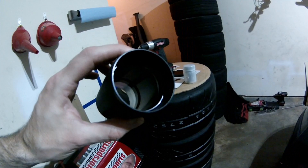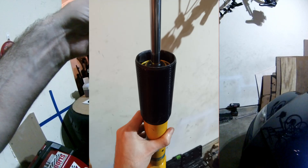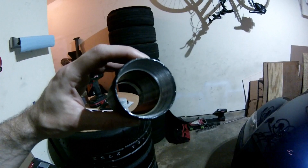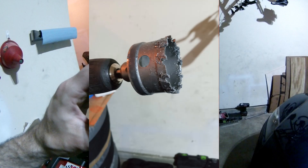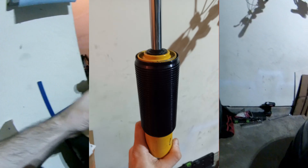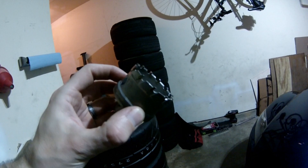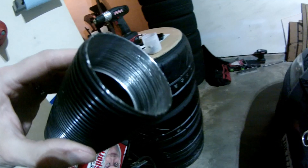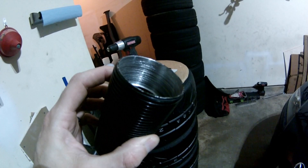What happened was when I inserted the threaded tube in this direction — sliding it down the shock body — it was sticking up too far, and that would cause the body of the car to collide with the body of the threaded collar. So what I did on the opposite side — this was an unsuccessful version — I got a big drill bit and actually machined down one of the stepped grooves on the other side so it was also a square shoulder, allowing me to reverse the tube to drop it further down on the shock body. This is a 53mm hole saw I got off Amazon or eBay — the problem was the teeth were a little too big in diameter, and you can see all that extra material that was cut off from the threaded tube body.